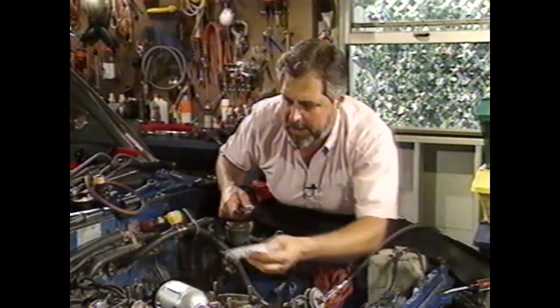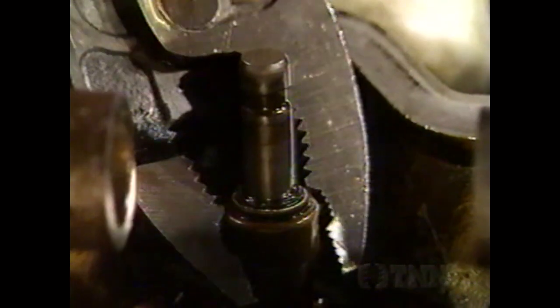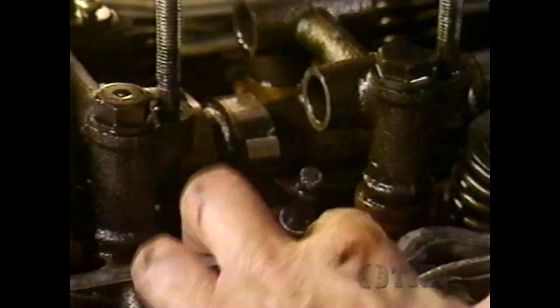We've got new oil seals — there are two different sizes, so compare them to be sure. To remove the old seal, just take a pair of pliers, grab hold of the seal, and pull it right off — lever it up. There it is — hard as a rock, the inside of it is all gone, flaking apart. That's why it was leaking. For the new seal, which has grease in it, push it on over the valve stem. Don't push on the stem — push on the seal, set it on top of the guide, and push it down. A little socket works fine — a couple of shots and you seat it nice and tight on the guide.